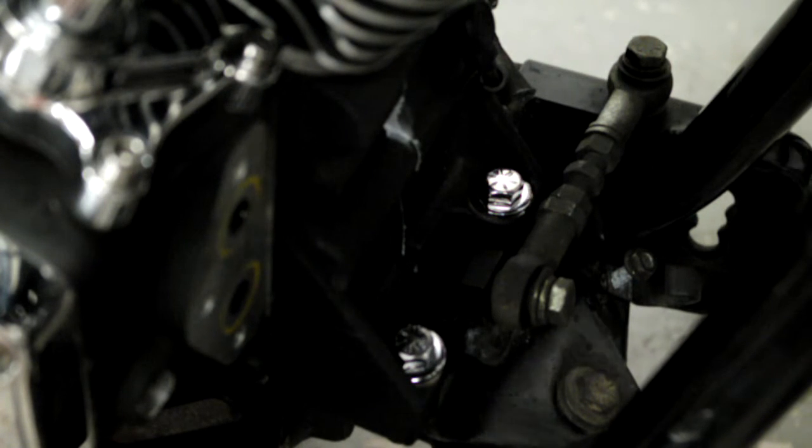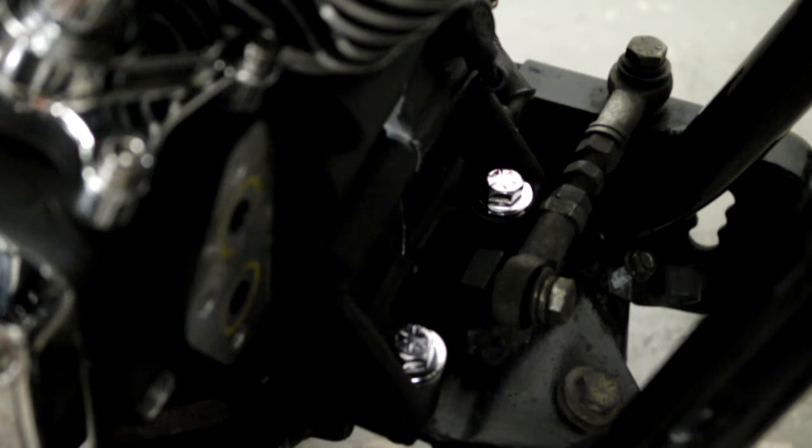Right, when you get to that point, obviously you want to nip them front ones up, but don't tighten them up straight away. I'll get them nipped up so that the gap's closed up, and basically what I do then is I get the head steady on and get the mounting on the top end, and then everything's sort of in line, and then tighten everything up. So, I'll knock you off for a minute and I'll come back.